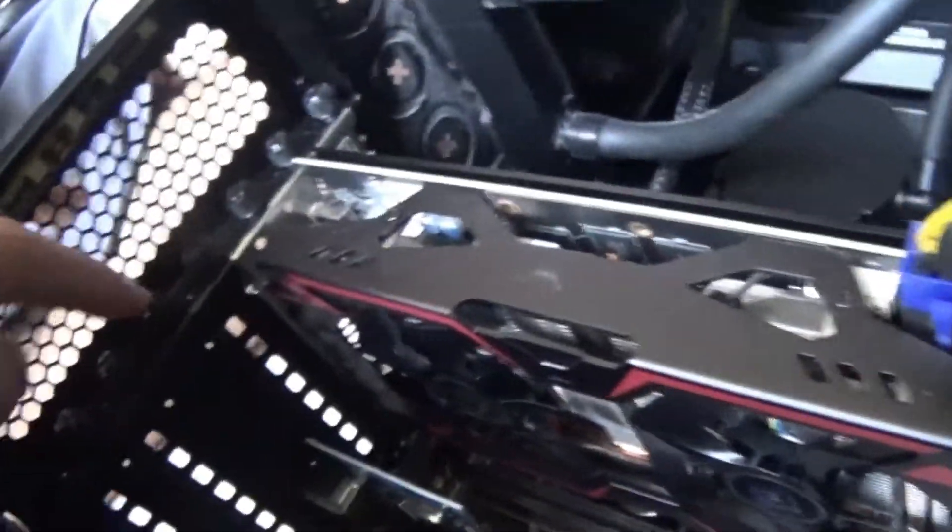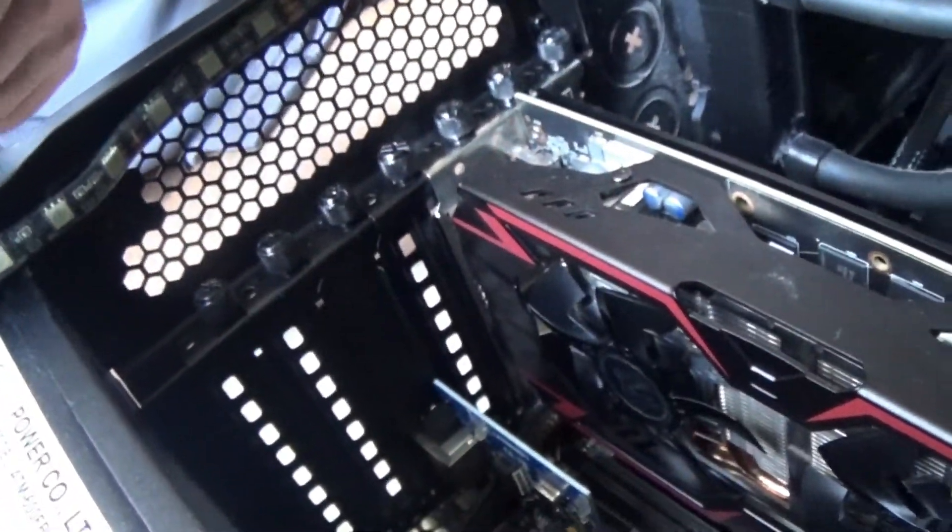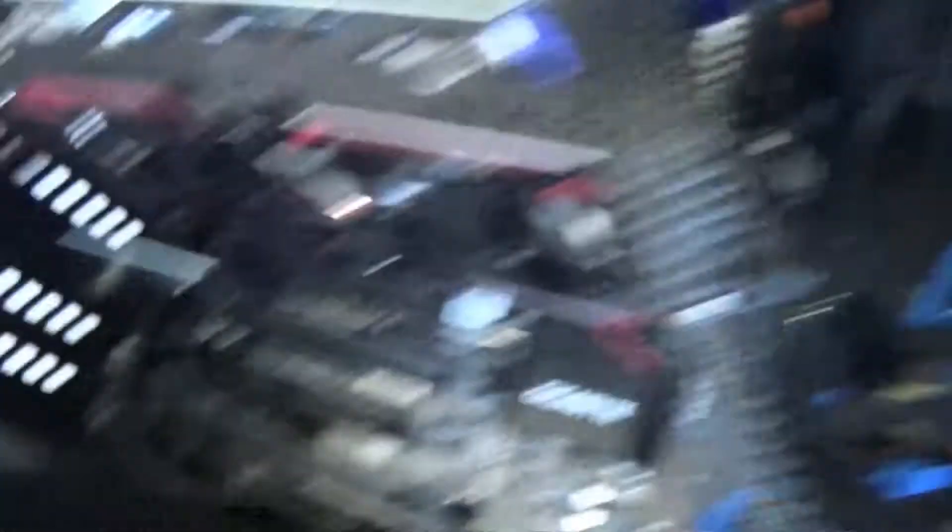Okay guys, so we put it in this one right here. It has a bridge for the power wire to go underneath, and it's the PCI Express one, in this slot right there. It's the 8 centimeter short bracket length, so the power supply wire can go under it, and then we screwed it into one of my expansion slots, and it fits very nicely.